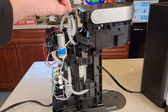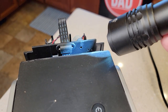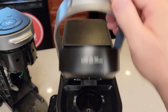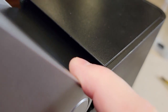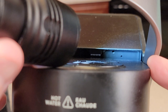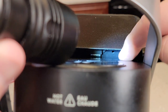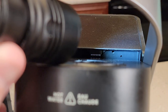So what happens is that port can get clogged. Right behind the lid you'll see that port — that's where the other end of that line goes, and that can get clogged. If you partially close the lid, you can see it's the top one on the left that I'm shining the flashlight on. You can get in there with a brush or something and kind of blow that away, or maybe a little vacuum to suck that away. See if that area is obstructed.